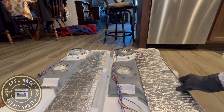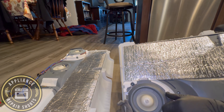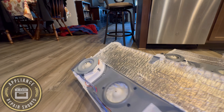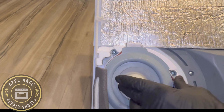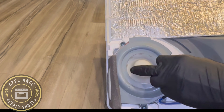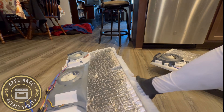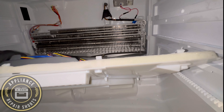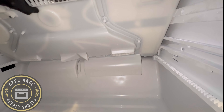That's a good fan. That's a good fan. Spins nice and smooth. No resistance. This is the bad assembly. That fan is actually still good, and that one is bad — super hard to turn, doesn't want to move. The sad part is, you have to buy the entire assembly. Now, if you do your research, you might be able to source the fan itself and pop it in without having to replace the entire assembly.